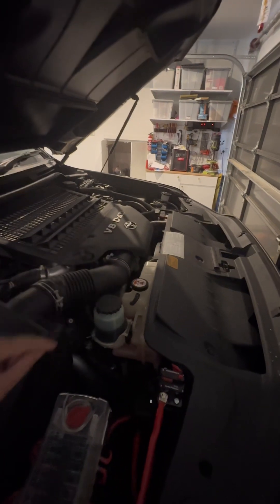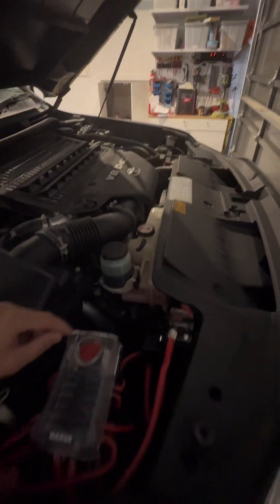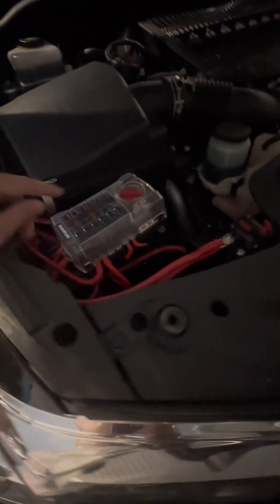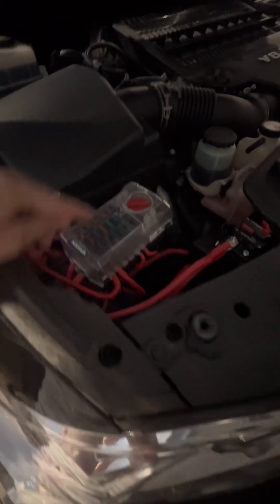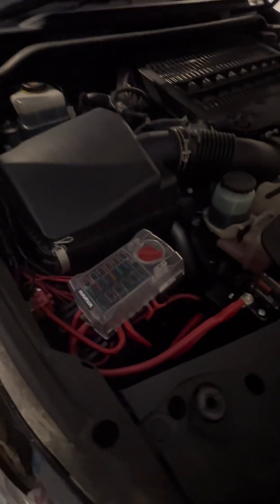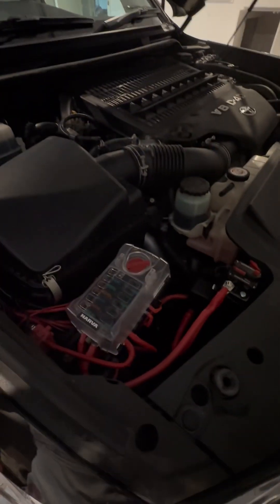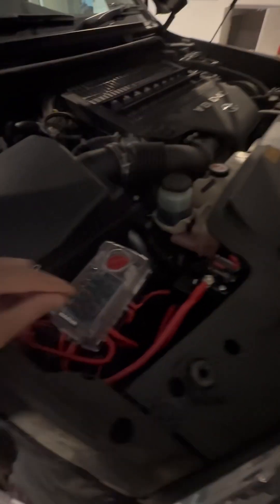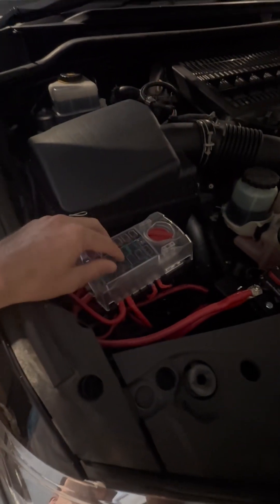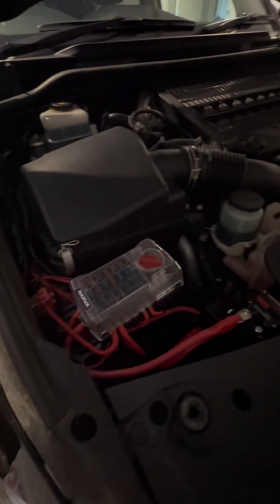I've chosen to go with this particular route. It might look a bit messy, but what I've got here is a setup where I've got a battery side and a relay side so I can power other things in the car. Essentially, you just need to wire the positive cables in a thick gauge — in my example, I've used 8 or 6 gauge when appropriate — all the way to the back of the car.